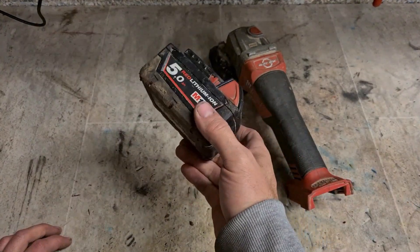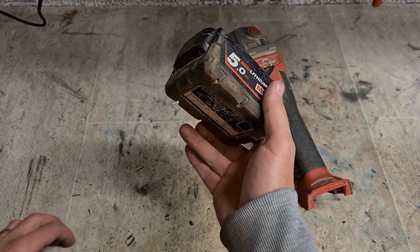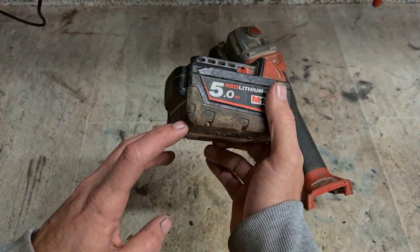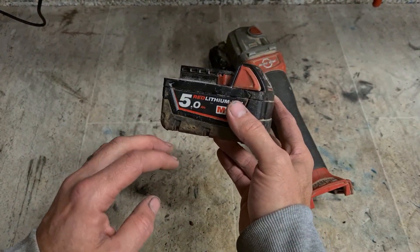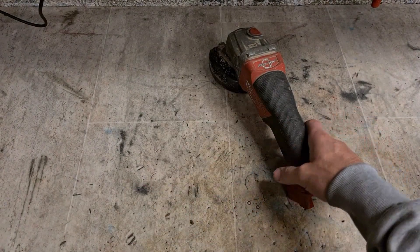So, that's either a bad battery or water damage. To be honest, I would say a wee bit of both. Obviously water got in, but the cells aren't corroded at all, so I imagine that's also a bad battery. Get rid of that.